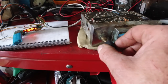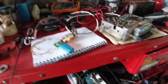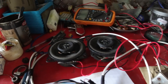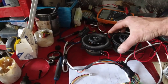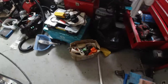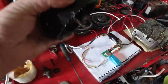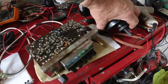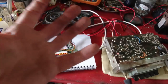It's got bass as well - it's pretty good, fine output. So I'm just going to box it up. I've got these crap speakers here - absolute rubbish, but I haven't got any others in stock - so I'm going to make a speaker mounting frame to put them into the dash up into the centre dash. I'll use both speakers, there's just enough room in the dash to get two in. You have to cut out - I use this hole saw here - this will cut two holes in some marine ply like this.